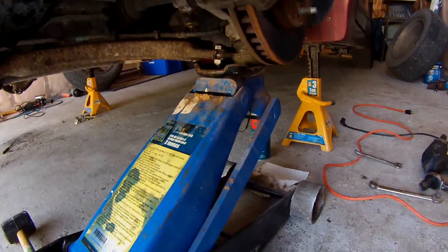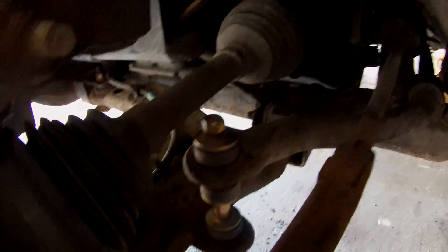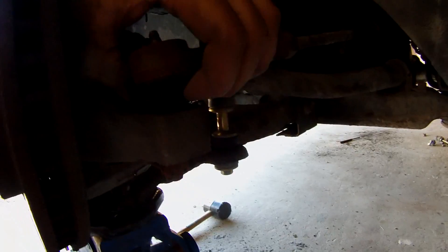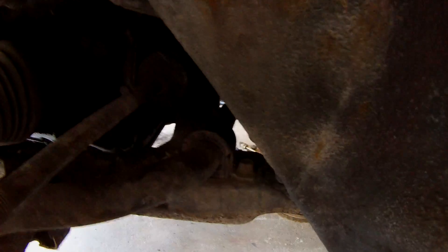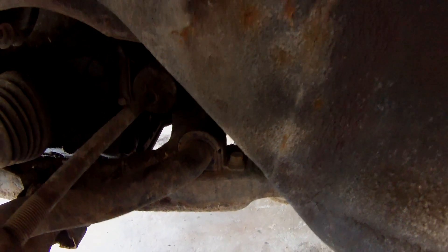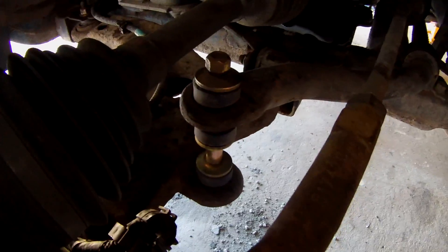I've jacked this up to where the ride height would be, fairly close. Go ahead and torque that bolt and this one here. I've also reinstalled the stabilizer link. Going to do the same thing on the other side. While you're in here, check your tie rods and tie rod ends — these ones are new, I just did these recently. Grease them up while you're here if they need it. Also check that bushing — that's a poly bushing from Moog, they're pretty good ones. Replace those rubber ones with poly ones, they definitely help. Same thing with the end link, double-check that. You can also do a brake inspection and anything else that looks out of the ordinary.